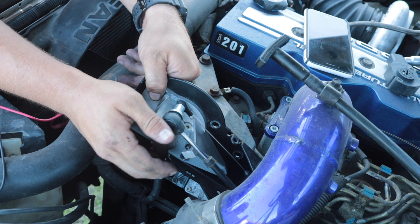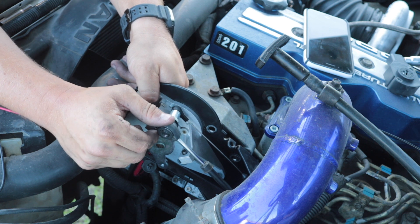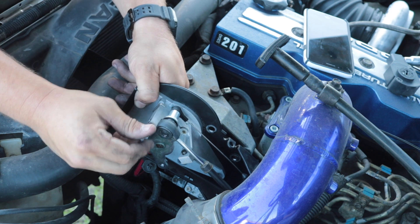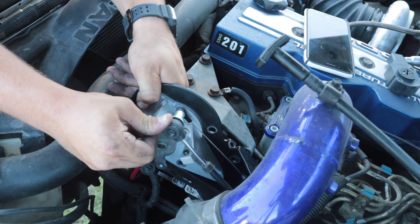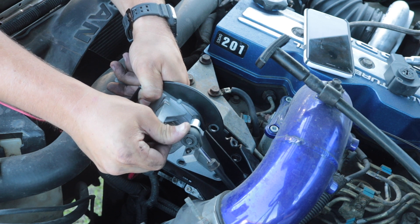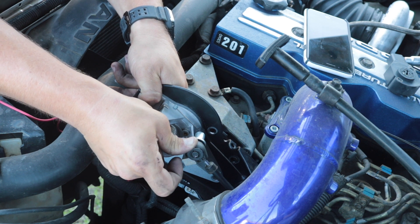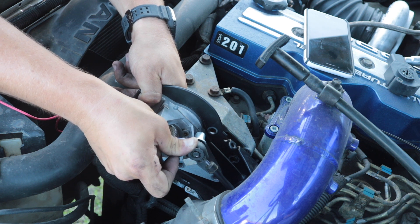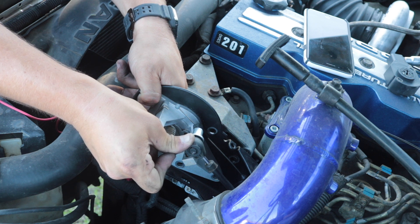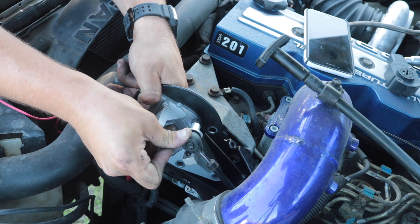Reading 0.5 — not quite 0.55 yet. Now we're going to go slowly on the throttle and watch for any crazy voltage spikes. We should end up somewhere around 3.8 at full throttle. Readings are coming through: 1.6, 1.5, 2.9, 2.8 — climbing as throttle increases.